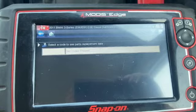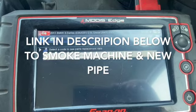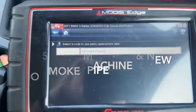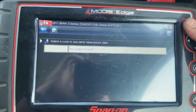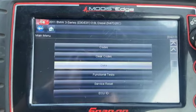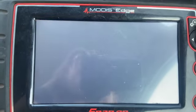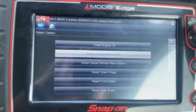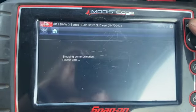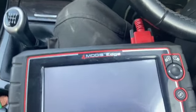It's always well worth getting one of them. Sometimes if it hasn't cleared, the DPF filter actually has a service reset on it as well. I have had on these BMWs where you might actually have to go into the service resets - there is actually a reset for the particle filter and you might need to just run it through them as well. That can sometimes come up with the same code. I haven't had to do that on this one - it's simply because the DPF got blocked up due to that pipe being split, giving all the wrong air readings and flagging all them codes up.